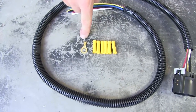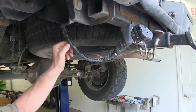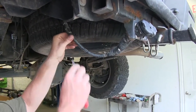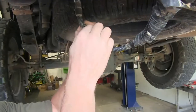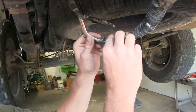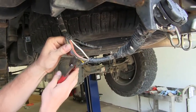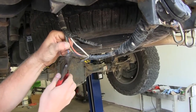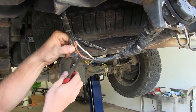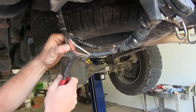We'll go ahead and show you how we installed the wiring harness. Let's remove part of our existing harness to get to good wires that aren't damaged. I'm going to get the sheath open, loosen up the wires, and cut them one at a time. Notice I've got my ground wire separate, which is my white wire.